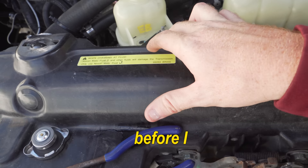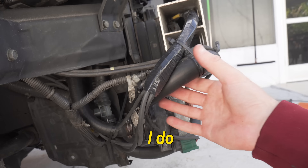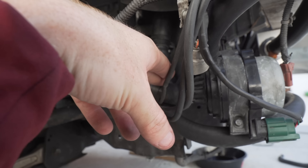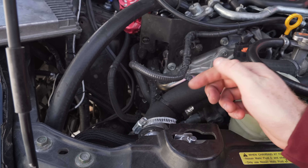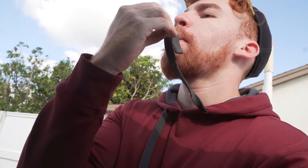Look at that view right there. I had to cut these little brackets that I had before and re-drill just because it sat way too far back and was hitting the motor, but we got it sitting right now. These two are good except down here - I do have to figure out what to do with all this excessive wiring. But you can see we got the sensor in here now - it's more secure, it's OEM with the adapter for the sensor so it's not gonna leak. A clamp broke on this side so I put a temporary one in. It's really hard making this look pretty when there's no space - it's functional, that's the most important thing.